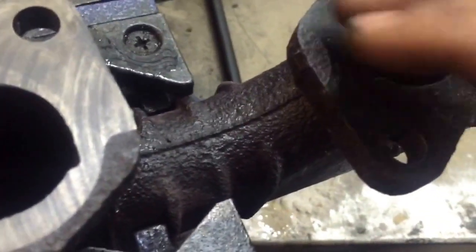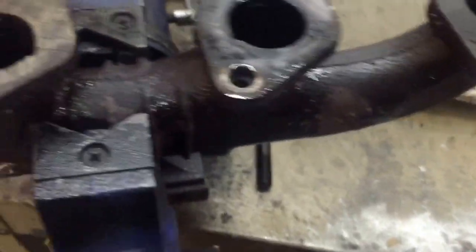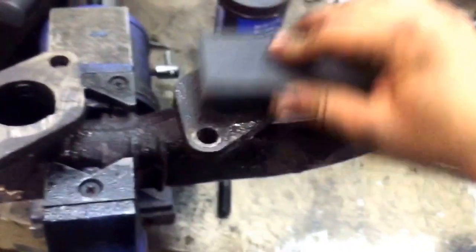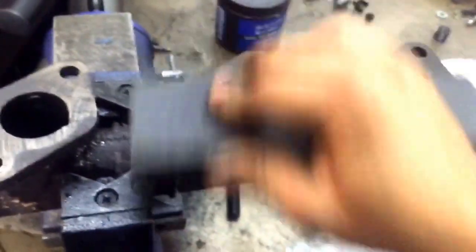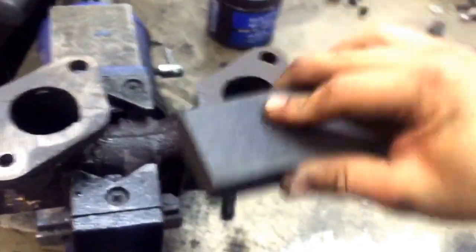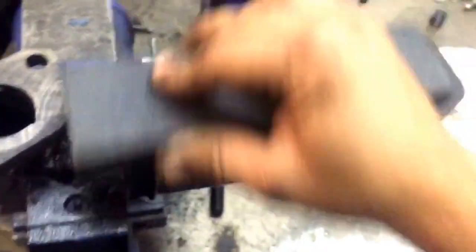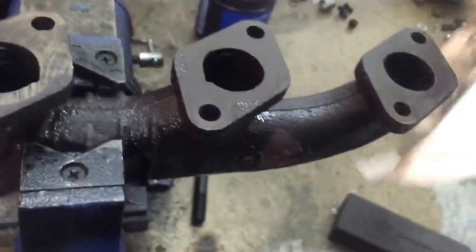This one is really kind of gritty, so I just let the WD-40 soak in a little bit and add some pressure. You can actually do two at a time with a nice stone block like this one — just do both of them at the same time. That way you know it's flat. It'll take maybe a thou off the metal if anything. This is the same thing I do on the mating surfaces on the block when I put the gaskets on.